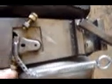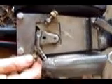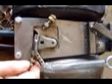So I'm hoping to get enough tuning by either changing the pressure of the spring, or changing these radiuses here, or actually adjusting the pressure of the spring with this to make this turbo work halfway decent. It doesn't have to be perfect, like a fleece controller would be, but if I can get a good amount of boost right off idle and neutral, I guess a lot of these variable turbos are getting in the neighborhood of 10 to 15 pounds just by goosing them in neutral, and not overdoing the boost on the other end. I want to try to get 40 or 45 pounds out of it. Whatever spring pressure and adjustments I can do to make that happen, I think will make this turbo work at least better than a fixed AR housing.